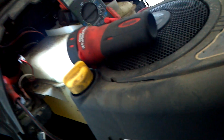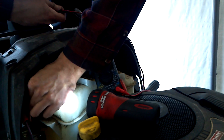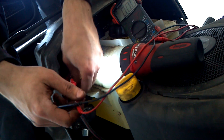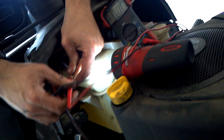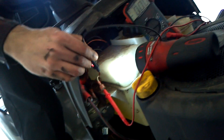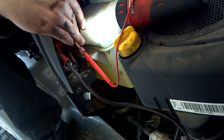What you're going to do is get out your battery tester again, and on your solenoid, you're going to pull the white wire. Carefully take your red lead and put it into the white wire, take your black and put it on a bolt or something on the chassis, sit back carefully, and press your pedal all the way down.